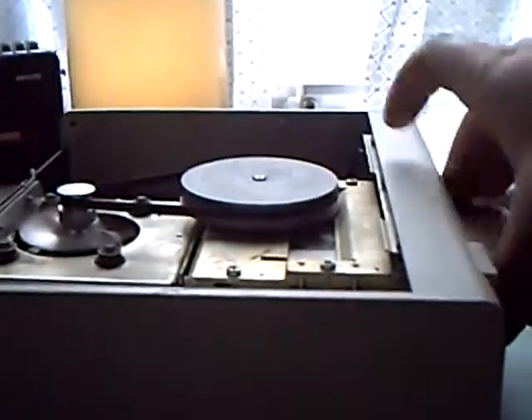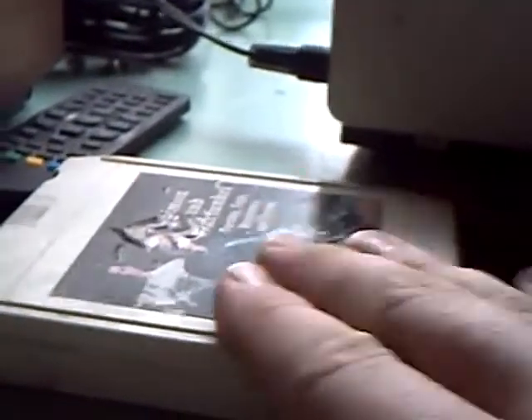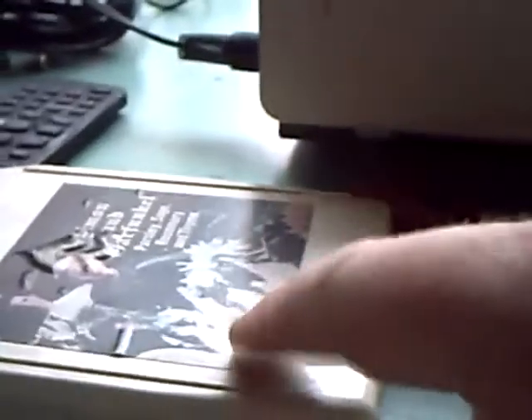Well, doesn't seem to be anything wrong with that, does it? This cartridge is a good one, but what I've done is replace the little spring-loaded brush that keeps the tape in proper contact with the playhead. Normally with these cartridges — if I put it on macro you might see — underneath the tape, the foam that does the job of pushing the tape against the head has just gone like so much gingerbread. So until I change the foam on that, not a good idea to play it, as bits could come off and gum up the inside of the tape or wrap around the heads — mess. Don't even go there.